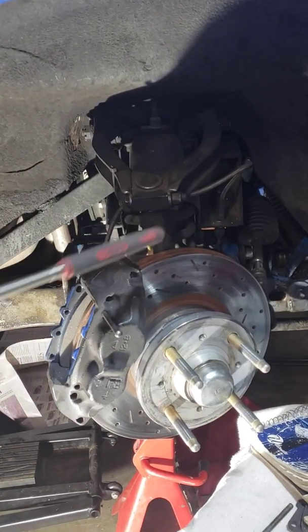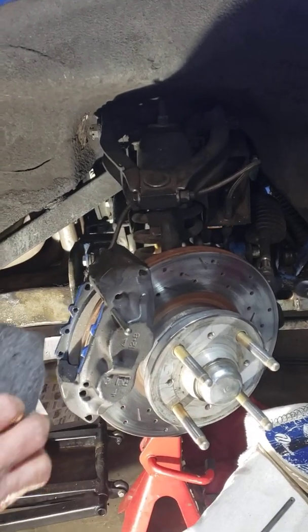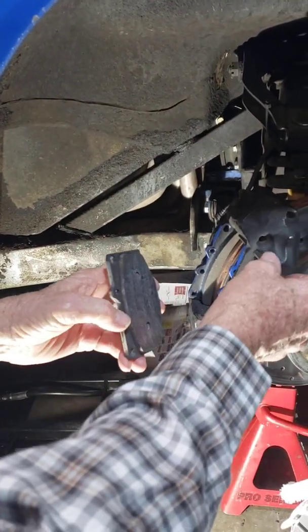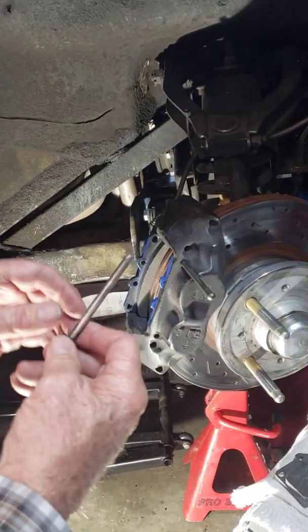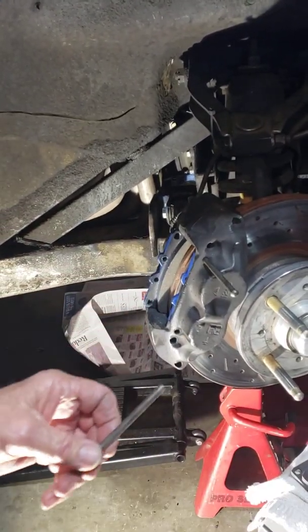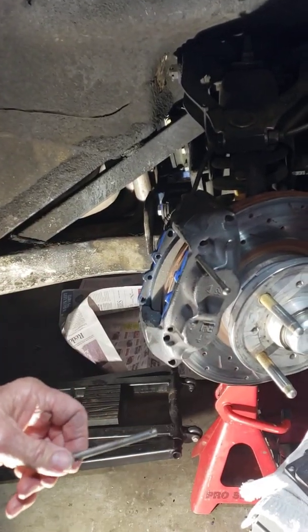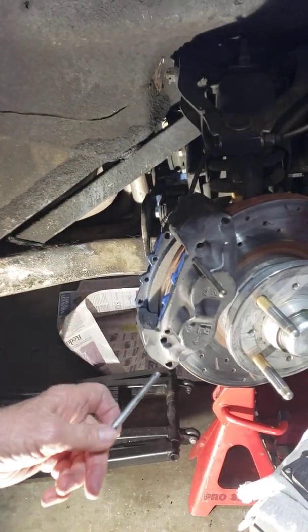When it comes to taking out your old brake pads at the end of the season — and this is what came out — it's about time to swap them. You take the parts out, and for these locating pins, you want to use some brake cleaner and clean them, get them shiny, and then lubricate them with some WD-40 or similar when you put them back in.